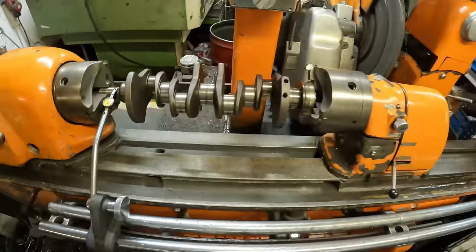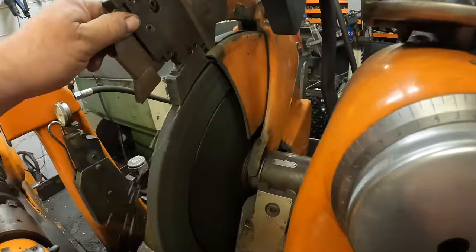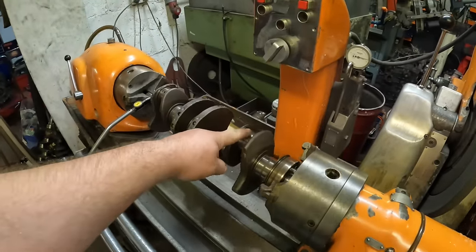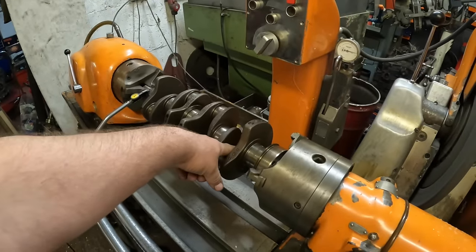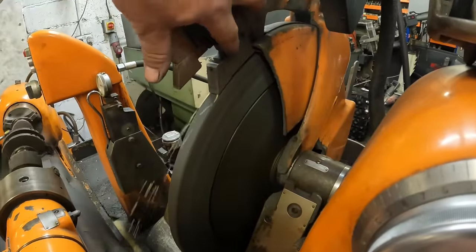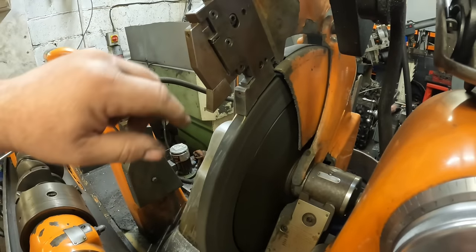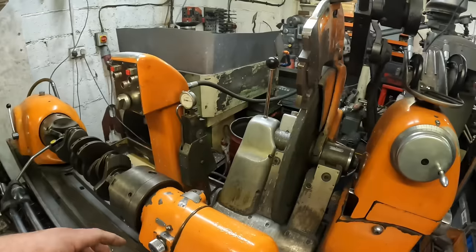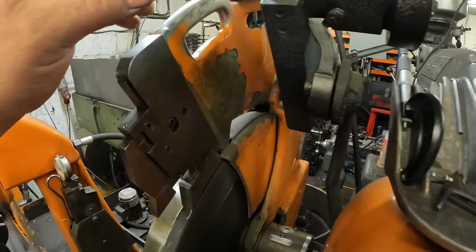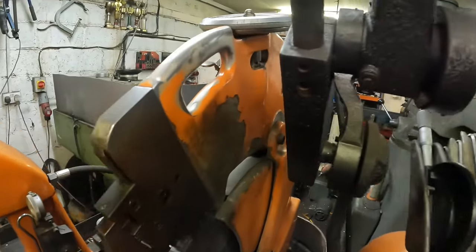So now I know that's running true, the next thing I need to do is set up the fingers, because I always do the big ends first. So I need to know what the size of the big end journal is standard, and then I put those settings into here, and then that sets this finger up, and then I'll set the rest of the fingers up so it grinds the crank properly. The first thing I want to do is, I don't know if the camera will pick it up, is in here